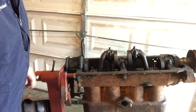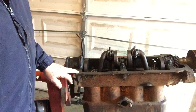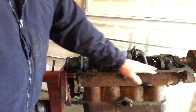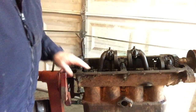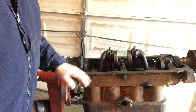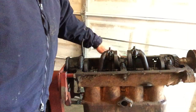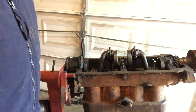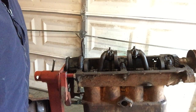Good morning everybody. Last night I took the oil pan off and used the wire wheel to clean off the gasket surfaces — they were pretty good, no nicks or gouges. I pulled the oil pump off; it was looking really good and pretty clean, but I've got that soaking in solvent right now to clean out the inside of it.